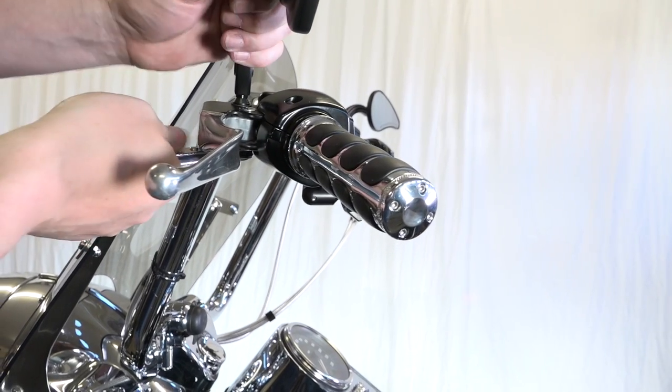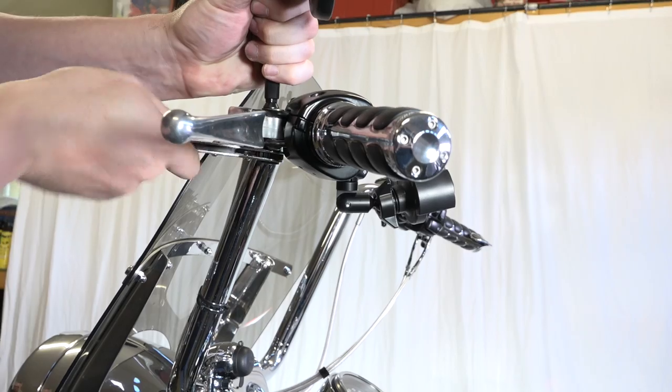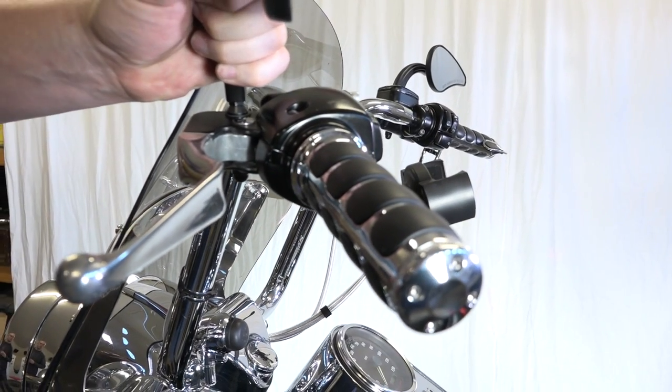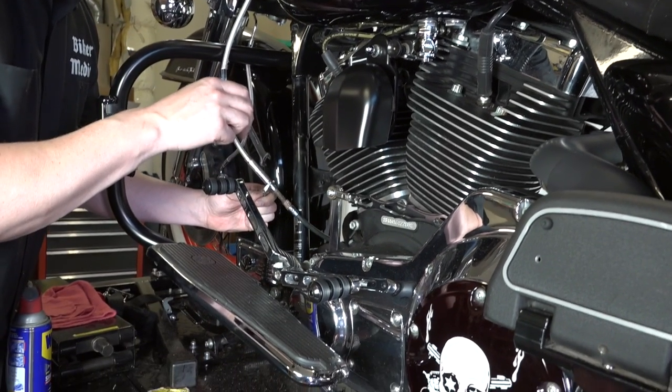With that said, what do you say we get wrenching? All right, now we're going to replace the clutch lever, and we're just taking the mirror off. Just a half inch acorn nut on the bottom with a wrench is what he's got. Just get it out of our way because it'll make it easier to get this pin in and out in a moment.